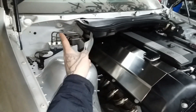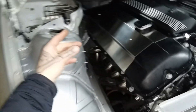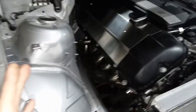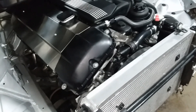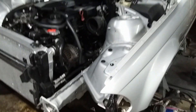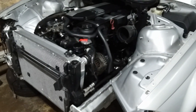He has two fittings going into the catch can, then the third fitting — the outlet — runs to his exhaust with the venturi fitting at a very precise angle. Whenever exhaust fumes are being forced out from the engine, it's actually putting vacuum on that hose and literally drawing out vapor, assisting the crankcase. That is one method proven to work on his circuit car: an exhaust evacuation system. But for simplicity, 9 times out of 10 within all my forums and groups, people simply vent their crankcase to atmosphere in turbo applications because it's very, very hard to control crankcase pressure any other way. Even Boris — he has an E30 with 1,200-plus horsepower with three world records — his valve cover simply vents to atmosphere with a catch can. Because it's very hard to regulate the pressures with these engines.